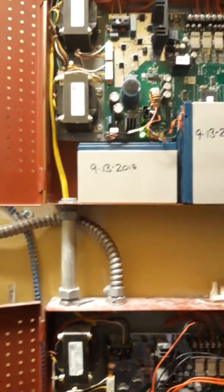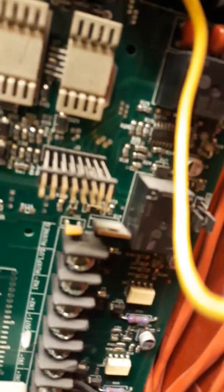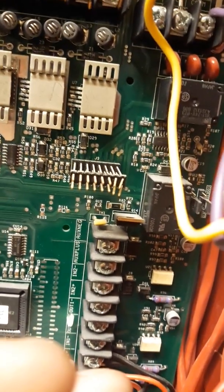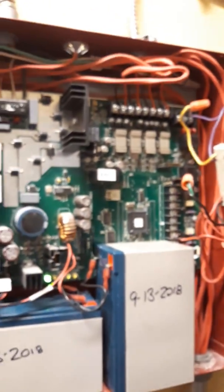That's all I'm going to do at the panel right now. I said I'm going to do a walkthrough of the whole building, but I'm not going to do that on video. Something else I noticed right here — these pins are bent, but they're not touching. I don't see any char marks and I don't smell any burn either. Alright, please like and subscribe guys — it helps me out. Thank you.